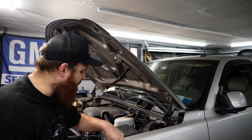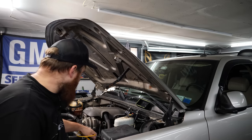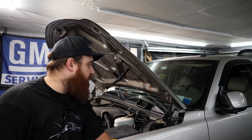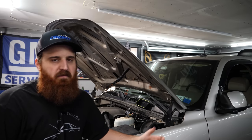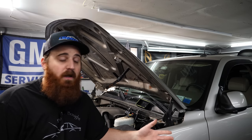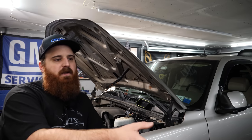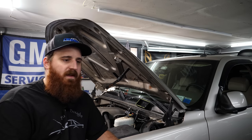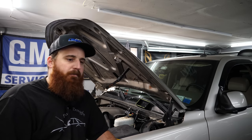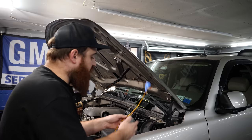For one thing, you could tie these two together, hook them up to a rocker switch, hook that to ground, flick the switch and the fans come on. That's a rudimentary way to do it but works for an off-road or race vehicle where you don't drive on the street. Another option is to get a fan switch. Like my Trans Am — it used a grounding fan switch so when the temperature gets to a certain point the switch closes a ground. For these LS motors, the heads are interchangeable so there's an identical hole in the passenger side head in the rear that just has a plug in it — you can use that for an LS-style grounding fan switch.